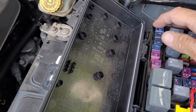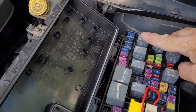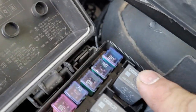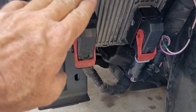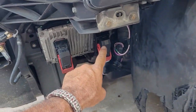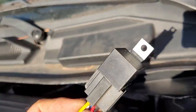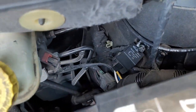The problem is the relay in the TIPM - the relay that powers the transmission valves. Check that fuse too - if you're not getting power, make sure that fuse is good. In my case I wasn't getting power at that fuse (K5 PCM relay). With your bumper cover off, the PCM is on the left and the TCM (transmission control module) is on the right. I bypassed that TIPM relay using one of these cheap five-dollar relays, which is mounted right there.